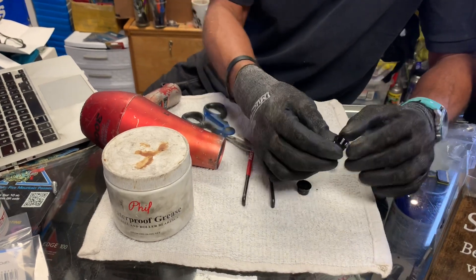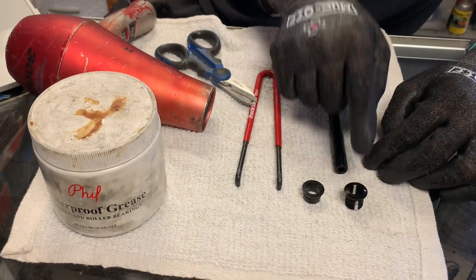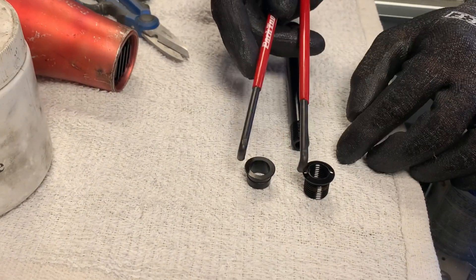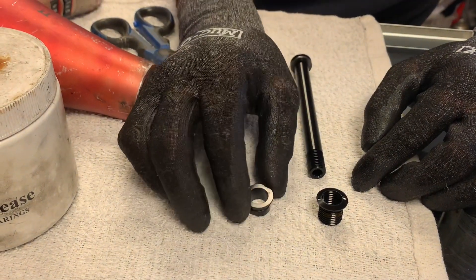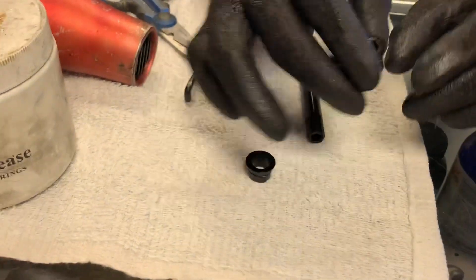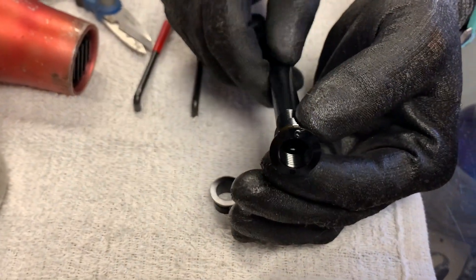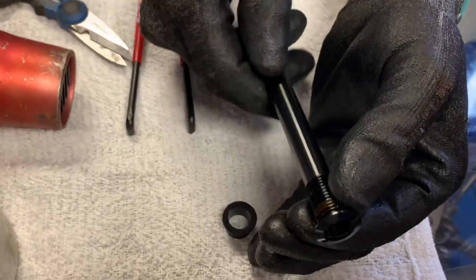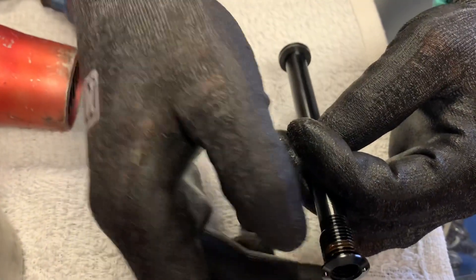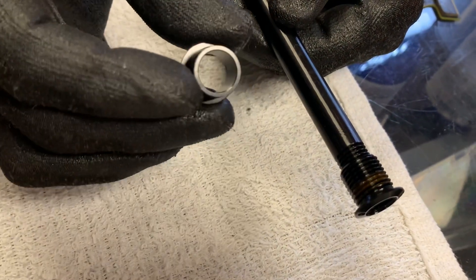So we have here one side that the spanner tool will go into — you can see the two holes there. Then you have the slip-through side, which does not have any threads on it. But this one is where the through axle will eventually thread into, so you go in here like this. When this is installed on the fork, it threads into the inside of this piece, and this is now going to thread into this guy.